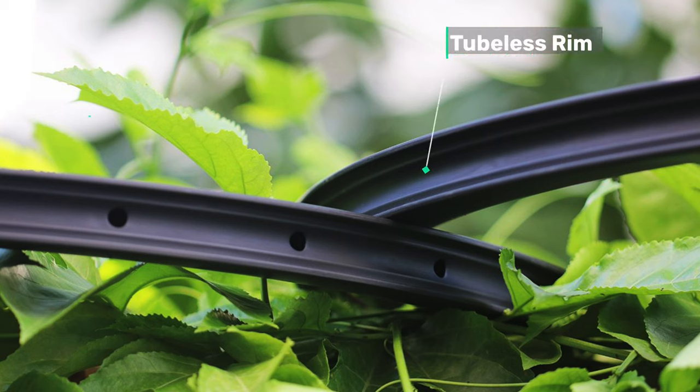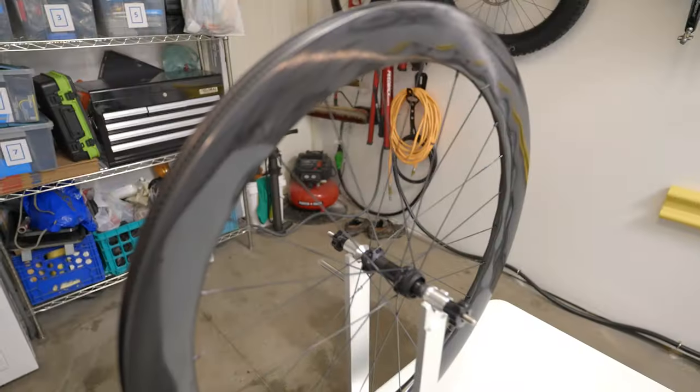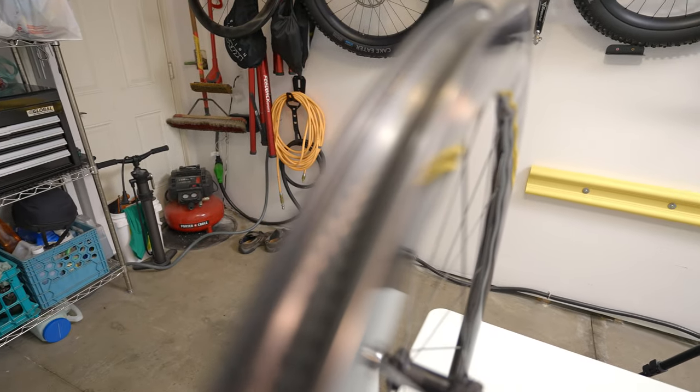The other thing that made this build challenging is that I went with a tubeless rim, not a tubeless ready rim. A tubeless ready rim has access holes drilled into the rim for every single spoke opening, and when the wheel is assembled you have to run some tubeless tape around the rim to make it airtight — it's the way most tubeless wheels are made simply because it's easier and cheaper. I prefer tubeless rims which have no access holes drilled in the rim for the nipples. It's a cleaner look and means you don't have to worry about adding or maintaining rim tape. The only disadvantage is that building up a wheel takes longer as each nipple needs to be fished through the valve hole to the hole opening on the rim. You can get good at doing this by using a magnet to guide the nipple to the proper spot, but it's still a time consuming process.